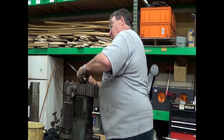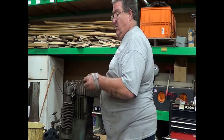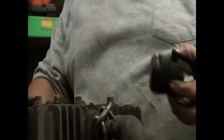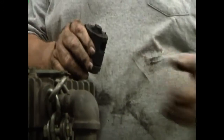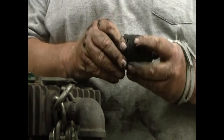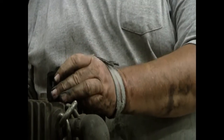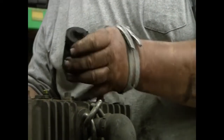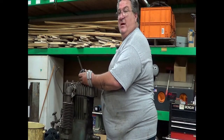I have seen these on the 350s — the 10-horsepower version of these, which I've literally rebuilt a thousand of. I have seen these valves so caked up from the rings passing so much oil that you couldn't take them out like this — you'd take the heads off, use a hammer and a drift, and drive them out from the bottom side.